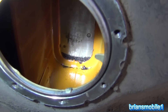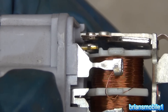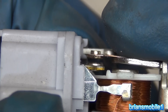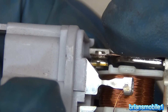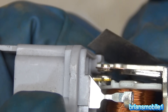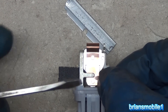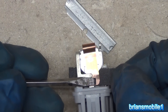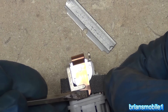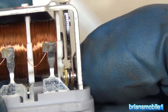It looks like plastic shavings. I'm going to see if I can salvage this just to get the thing going. If you look between those two contacts, there's a little thing right there that sticks up, and whenever you go to close the contact it can't close all the way - it just hits that little piece of carbon. So I'm going to take this little piece of razor blade - it's only thin enough to get in there without hurting something - and just chip it off. That failed miserably; it's like welded on there. So the next thing I'm going to try is just dragging sandpaper through - put it back, push it down, drag it through, and repeat. Wow, that was surprisingly effective - now it makes great contact. I'm so glad I filmed that part.